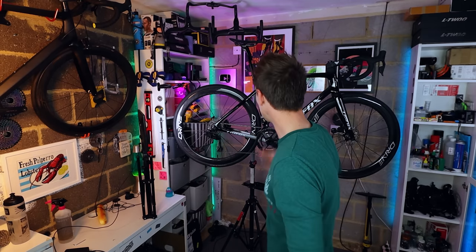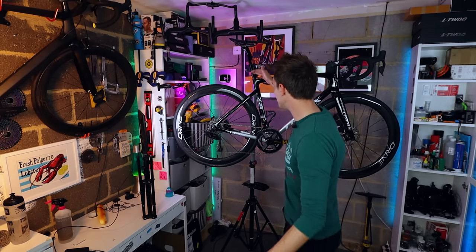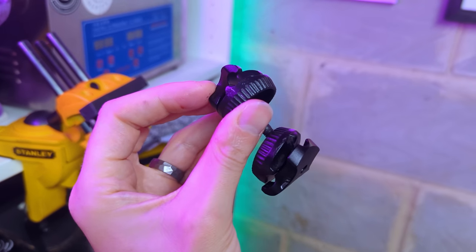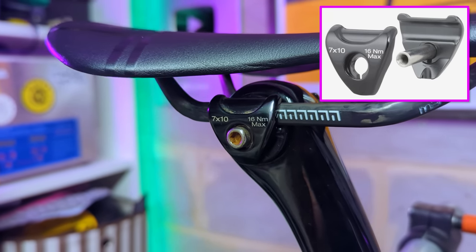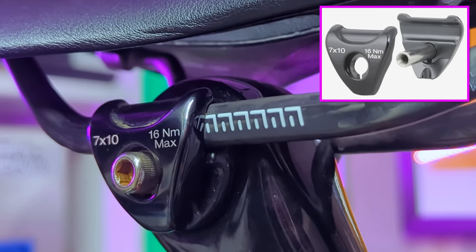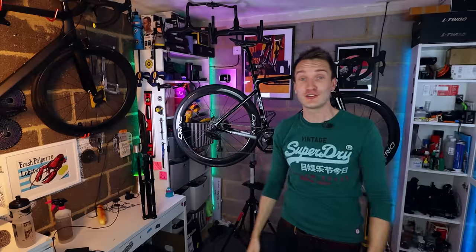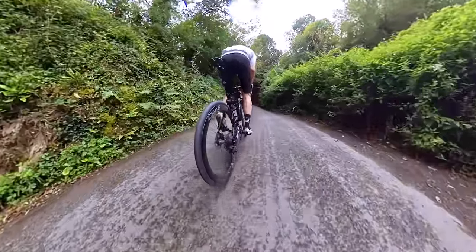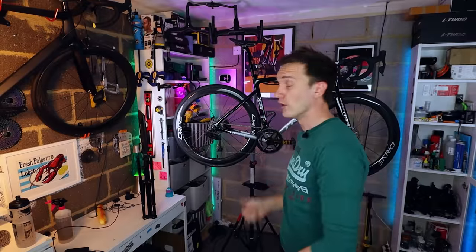The included aero handlebars surprised me — most cheap carbon handlebars I've tried feel pretty flexy in the sprints when you're holding the drops, but these feel nice and solid. The seat post hasn't slipped into the frame at all — I've put some silicone sealant on the interface to stop water ingress, which is also really easy to remove. With grip paste on the seat tube and the clamp tightened to six or seven newton metres, it hasn't slipped at all, which is new for me with cheaper frames. The saddle clamp needed adapters for my oval carbon saddle rails but has been absolutely perfect — no creaking or shifting. Overall this frame is very impressive, fair play Trifox.